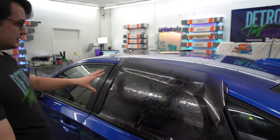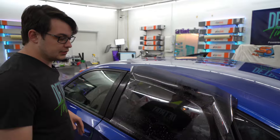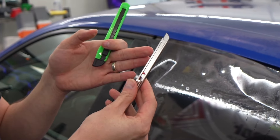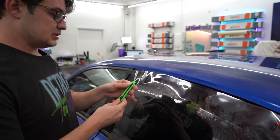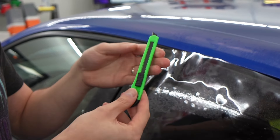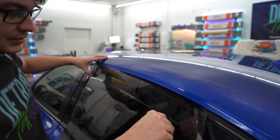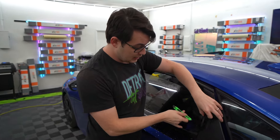Now that the pattern is mostly cut out, I'm going to take my handled squeegee and use that to fix the tint to the window — kind of like a light tack so the film won't go anywhere. From there I'll roll it down and expose that top edge. Here's where the knife options change a little: you can cut a beautiful top edge with the stainless steel blade, but if you press too hard you'll create a little groove in the tint. To fix that, I have a thin carbon steel blade in a more lightweight plastic holder. When I press against the film it won't create a groove and still cuts a very nice, clean top edge. You can use either one and get a very nice result.